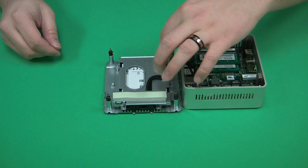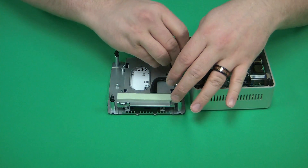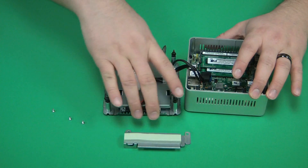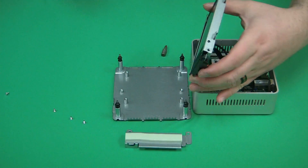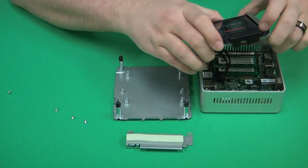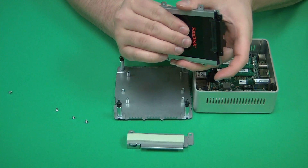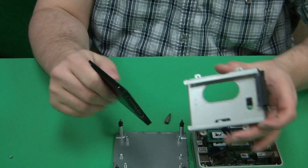There are four screws you need to remove — just unscrew all four. Once you have the screws removed, just remove this piece here and set it aside, and then the drive will lift off the bottom plate. By default, you should have no other screws holding the drive in, so you should just be able to get a pretty good grip on the drive and then pull out and slide it out of the slot.